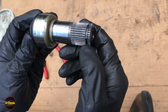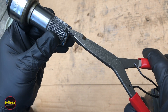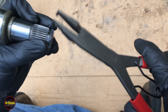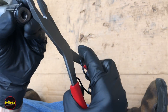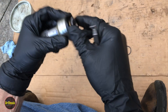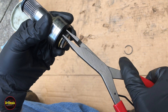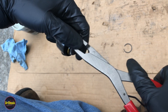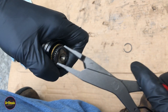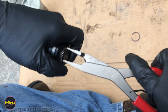The first thing we're going to want to do is remove these split rings. We can use a type of snap ring plier that's got a very thin tip to accomplish this. You just want to make sure you're maintaining control of this ring so it doesn't go flying. These are typically painted yellow, although only this outer one seems to have retained that paint.